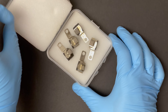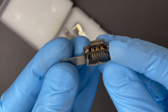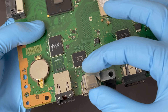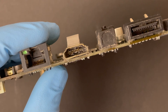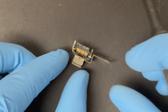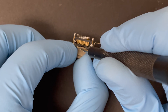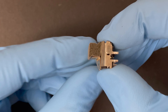As for replacement HDMI ports, these are salvaged from broken consoles and I had to buy them all the way from China — I couldn't find any new replacements for the PS3 fat. It's a very unique port. However, that mounting hole was dropped in this revision of the PS3, so this will be a good replacement for a launch model, but it's going to need some modification to work on this PS3. Luckily, it's a very easy modification, so let's go ahead and get that taken care of.